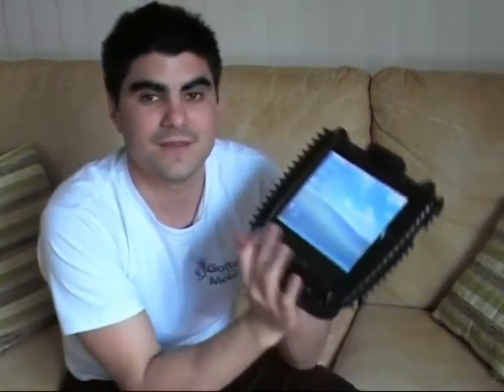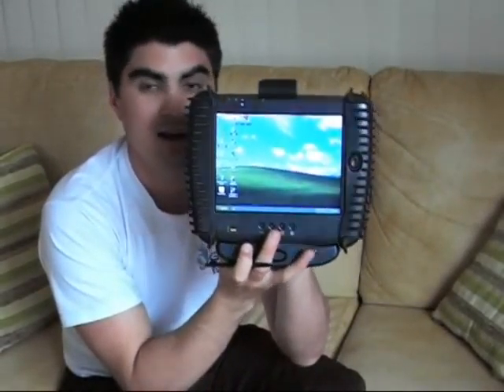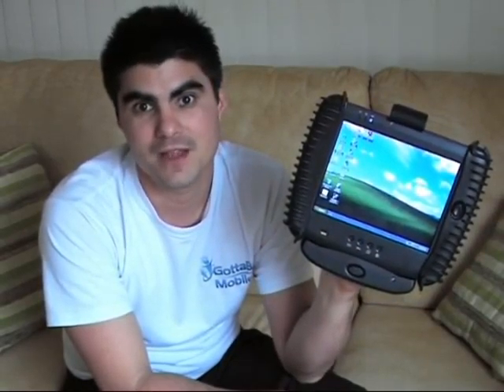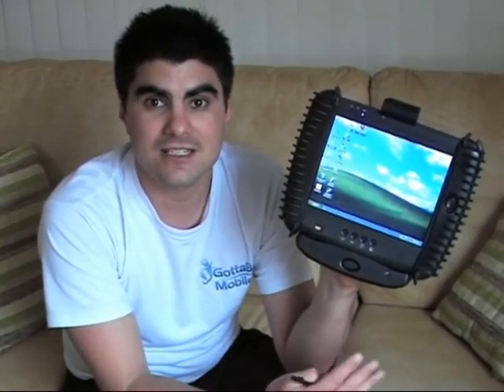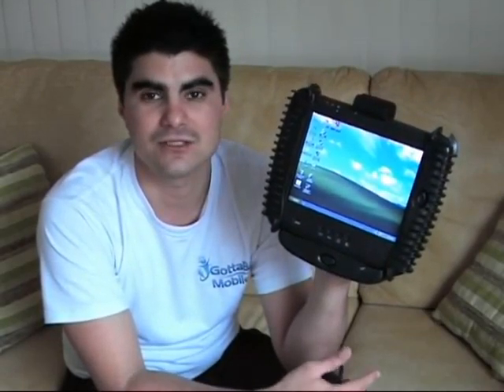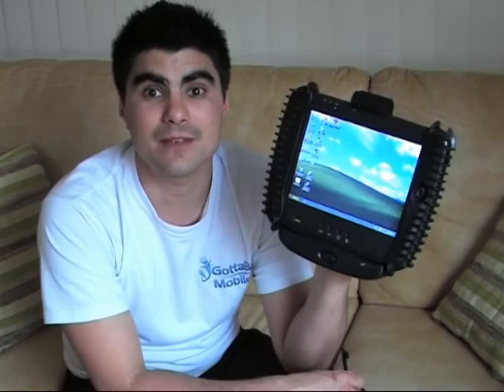When you look at the machine in a vehicle having this solid state disk drive - you can get an 8GB hard drive, or a 30GB spinning hard drive if you want to go a bit larger. But the main benefit of having a device like this is that you're going to use it in an ultra rugged environment. By having a solid state disk as your main hard drive, you're taking away the concerns with vibrations. So this is really one of those devices that has the potential to really be used amongst companies.